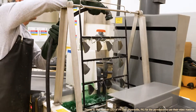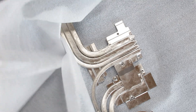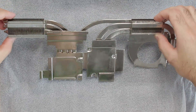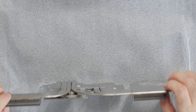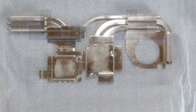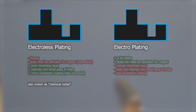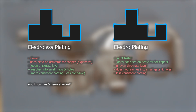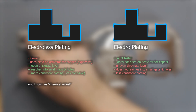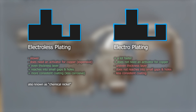15µm was the most common value for heatsinks I found on the internet. And the best part — all of that cost me only 32€. Nothing to regret; the end result looks awesome. By the way, there are two methods to nickel plate a part: electroplating and electroless plating. What I just described is electroless plating, which means there was no electric current involved in the actual plating process. Commercial products usually use electroless plating too, because it's easier to do in mass and creates a very robust, consistent layer with even thickness. Electroplating on the other hand allows nickel to be applied more concentrated on specific spots and the whole process is a lot faster, but it tends to form layers of uneven thickness because the nickel atoms concentrate on edges instead of the flat areas evenly.